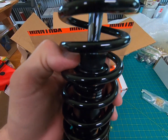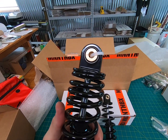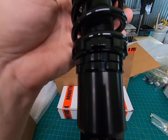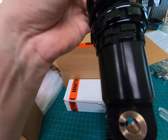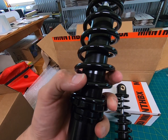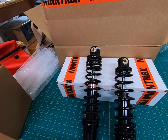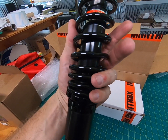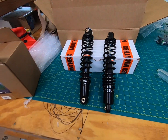There's a small rubber bump stop in there, a nice billet aluminum shock with a threaded body and bronze bushings. A great feature is the adjustable threaded body — you can adjust your ride height depending on where you put the bottom adjuster nut. So if you're really heavy like me, you can adjust that up so your sag when you sit on the bike won't be so extreme, while still providing the same spring rate with a higher ride height. That's definitely not something the stock shocks offer. The valving inside is also going to be different, providing a ride more suitable for the heavier rider.